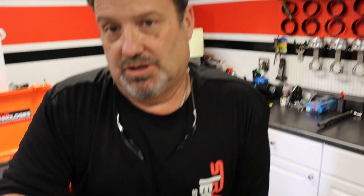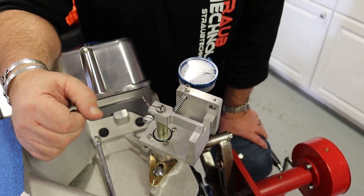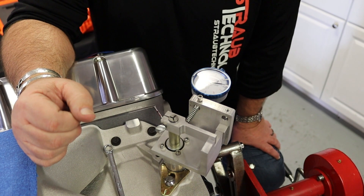I can do some quick math — the average of those three is going to be thirteen and a half because we are right in the middle of it. If we are going for a range, and we have gears from 3 thousandths all the way to 55 thousandths, you are going to want a gear for thirteen and a half thousandths, and the range is somewhere between five and seven. So we are going to go with a six thousandths gear. You want a six-thousandths oversized gear for this engine — this is one of our customers and we will be putting a six-thousandths oversized gear in his motor.